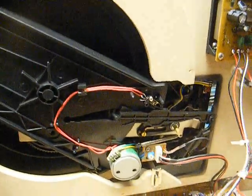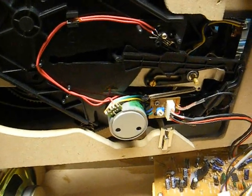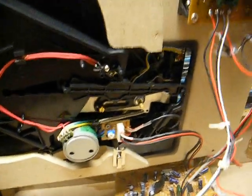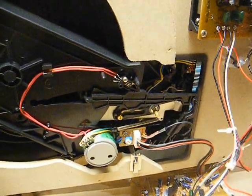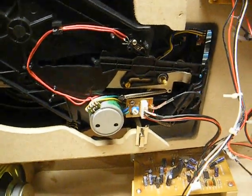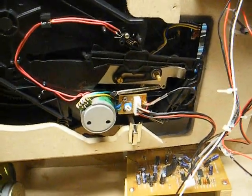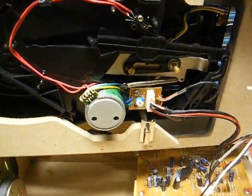You can see our all-plastic turntable mechanism with our little cheap DC motor here that has a lifespan of a low number of hours. What usually happens to those motors is the brushes either wear out or the bushings wear out, and that's when you start having problems.